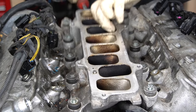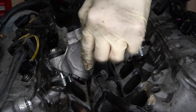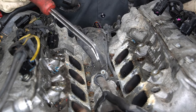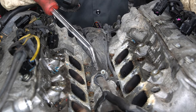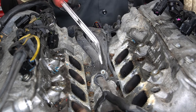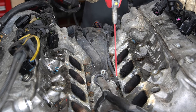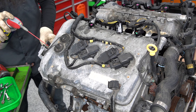That is goopy feeling. Getting this piece of the manifold off is going to expose our thermostat. I would say there's a handful of common failures on this engine, and the thermostat is one of them that's kind of high up there — not hard to replace. But remember, this is way easier the way we have it than it would be with the engine still in the car. Go ahead and use our Specialist Silicone — get this hose sprayed down, this connector here, and these two connections.